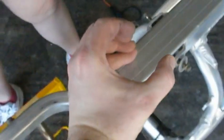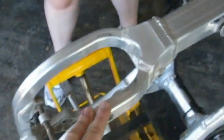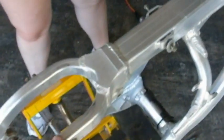No, you don't. But we need to raise it up because the exhaust pipe comes through. Right now, the exhaust pipe's going to try to come through here, and it can't because this is obstructing it. So if you raise the Y up, the exhaust pipe can exit through the frame, similar to how the old CR-500 frames did in the past. In fact, the CR-250s are still the same, well, up until they stopped making them. But yeah, the exhaust pipe's going to exit out the middle.